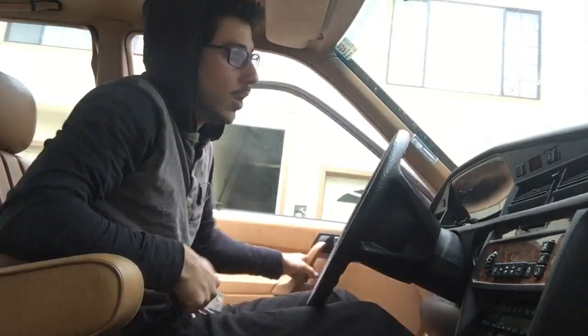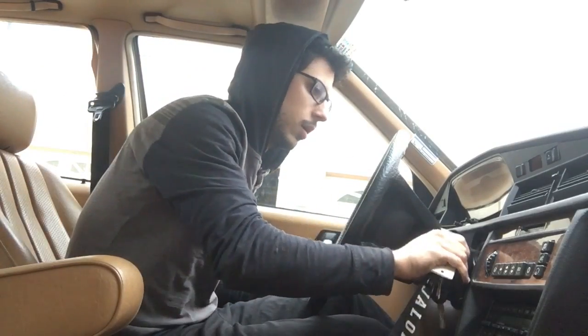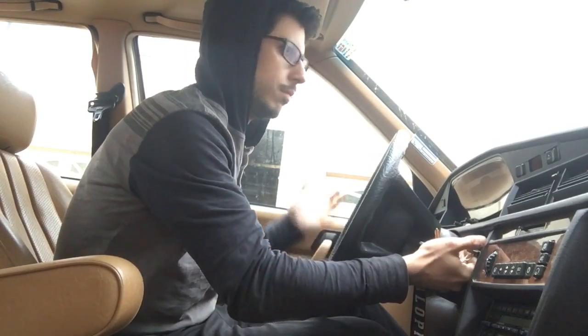I don't know. Okay, guys, sort of figured out my issue. This guy right here. I just cleaned it up. Made another gasket for it. The one that I made out of double-sided tape melted away. But now since I created an actual gasket, watch how fast it cranks over. Pretty fast. Only thing is, it leaks and the internals are bad, so that piece does need replacing and it's giving me a rough idle. But every time I turn the key, it cranks over. Look. Perfect. Look.